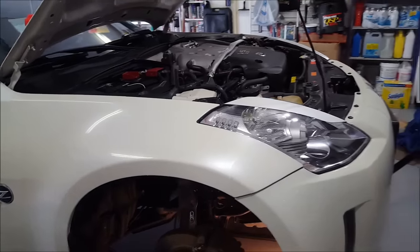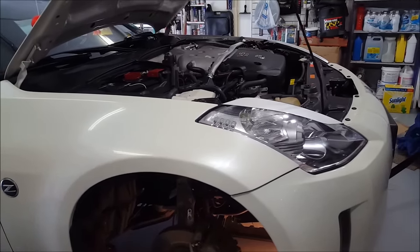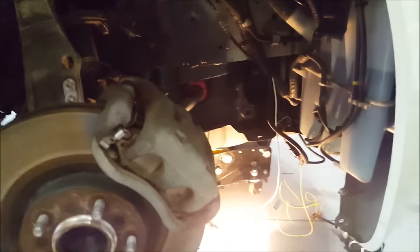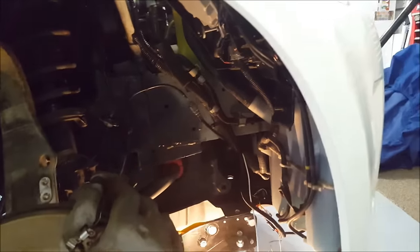I started wiring up the lights. As far as lighting goes, this is relatively high on the difficulty level. You have to prop the vehicle up — I have axle stands, wheels are chocked in the rear, and my jack is also supporting the middle of the car just in case. You will have to remove all the fender lining. Don't be lazy — take the wheel off, remove the fender lining, it's going to make life a lot easier. On the right side is the hardest side because you have the windshield washer reservoir to deal with, so you want as much space as possible.